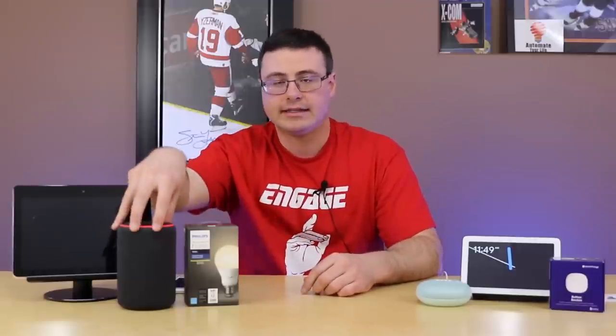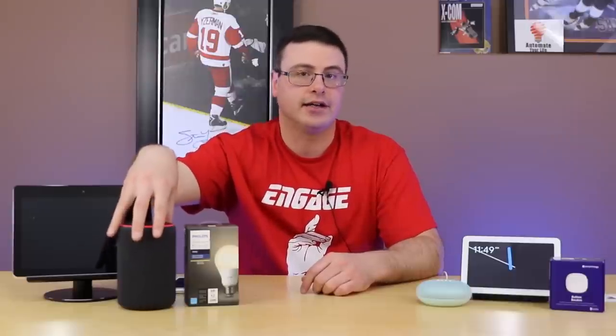The Amazon Echo Plus has both a 2.4 and a 5 gigahertz radio on board, so I can move it to a 5 gigahertz Wi-Fi network and stop this interference discussion entirely. In general, Wi-Fi is moving in this direction — we're going to eliminate a lot of these B, G, and N wireless devices over time. If your router doesn't already have 5 gigahertz capability, it might be time to look at one. Note that 5 gigahertz doesn't go as far as 2.4, so larger homes may need two or three routers or a mesh network.